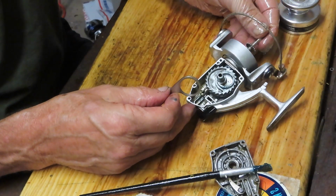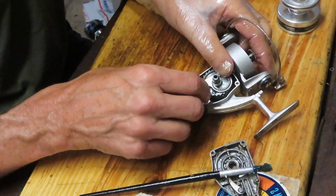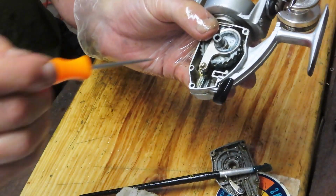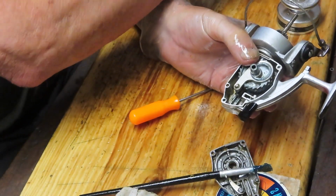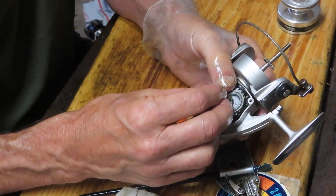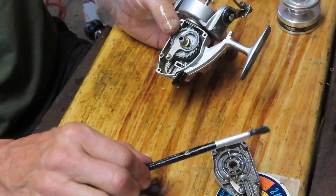And then when you bring your axle shaft down, find the hole, mount the stud into that hole, and make sure that that stud goes into that groove that we just put a little bit of grease in, that big long, elongated groove right there. There's one shim washer that goes up on top, and that goes here. And you notice there's just a very little overlap onto that crosswind arm, but that's what's going to hold that in place.